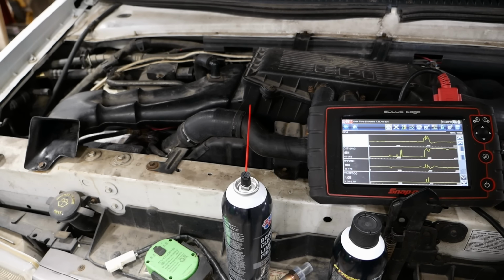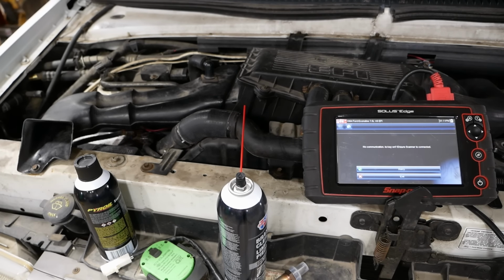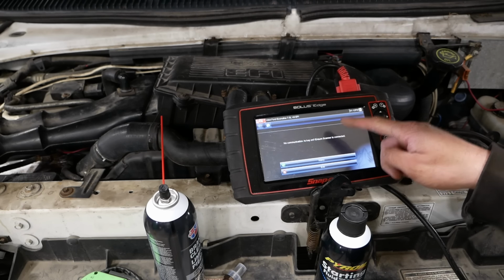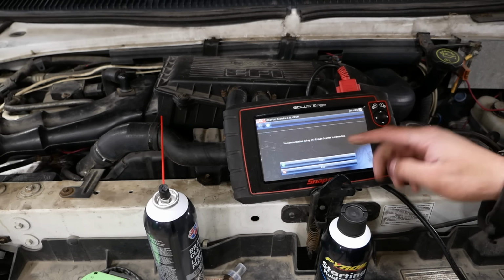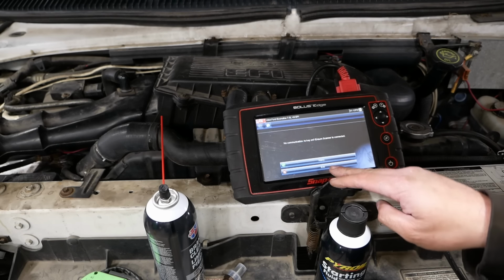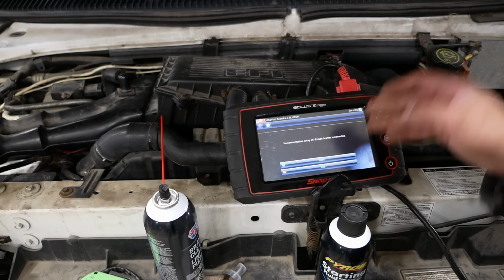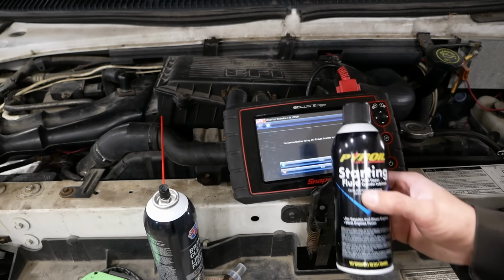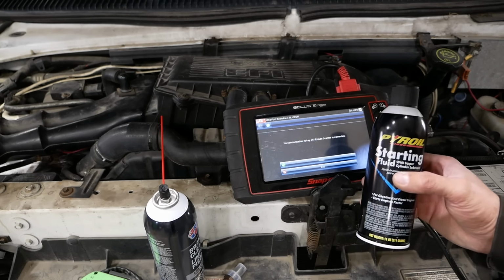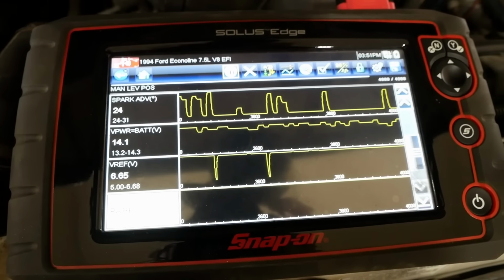Now it's stuck high again. All right. I mean, it was stuck high. The O2 sensor was stuck high. Then it was stuck low. But it didn't seem to really make any difference on the fuel trim. It was in closed loop. Then it was in open loop. Didn't really seem to make any difference. Sometimes it responded to an artificial rich condition. Sometimes it didn't.